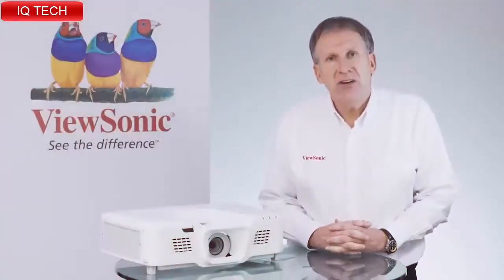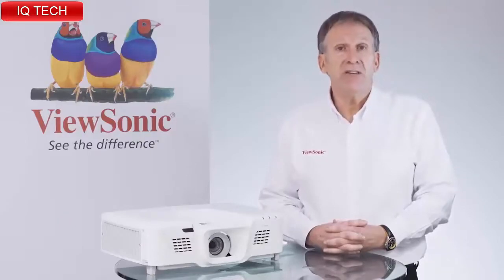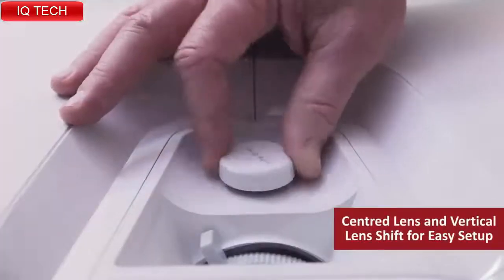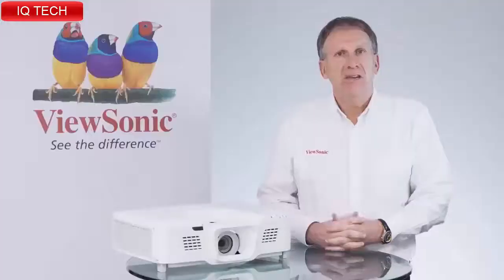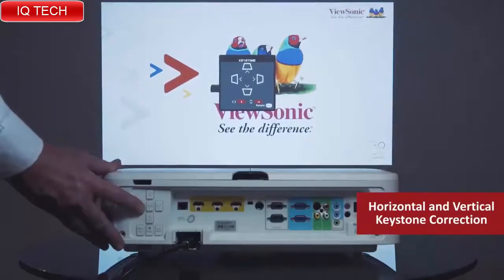So, having decided on the positioning of your projector and its connectivity, the next consideration is how you align the projector to the screen. The Pro 8 series provides a great deal of flexibility with image alignments. Now, this is by having a center lens and by using vertical lens shift. If there are image distortions, you can use the horizontal and vertical keystone adjustment to give you perfect image alignment.